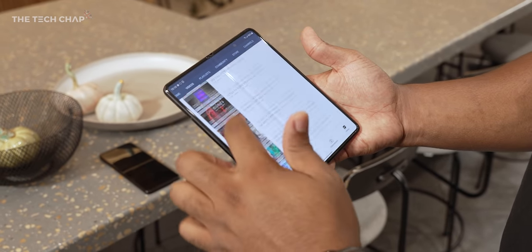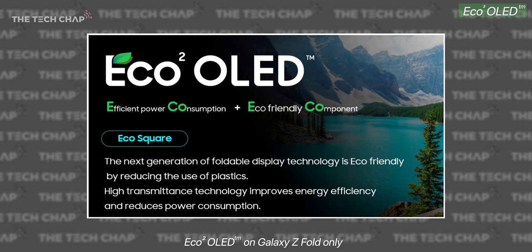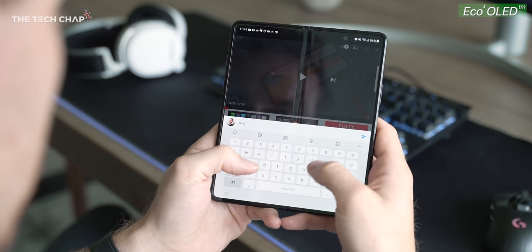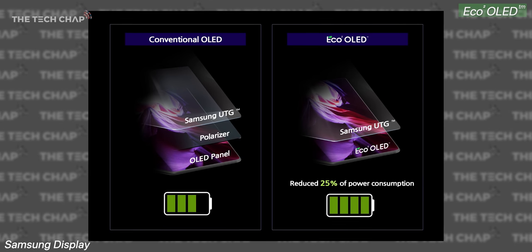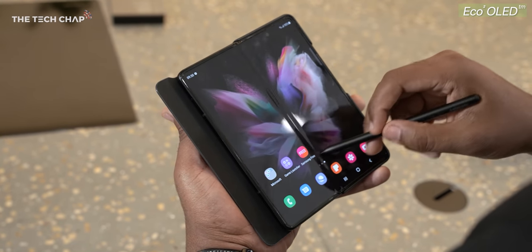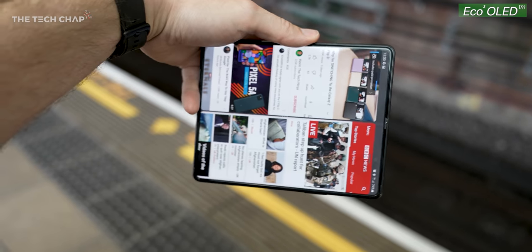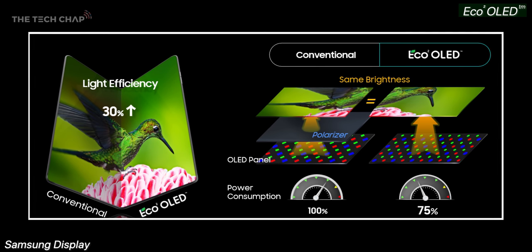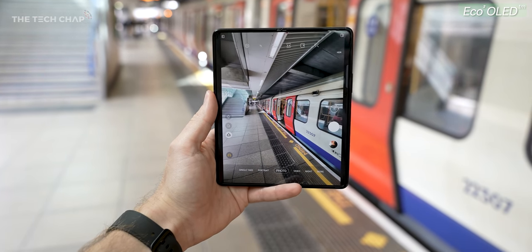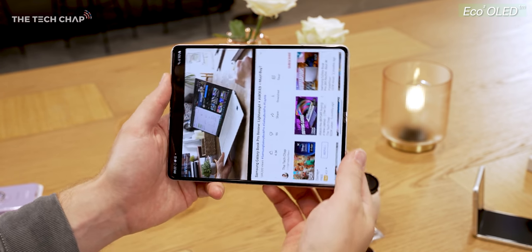So: sharper screens and better balancing of green light. But there's another benefit of the Fold 3 — eco square OLED — which is Samsung Display's push towards efficiency and eco-friendly components, specifically using less plastic overall. The efficiency part is particularly interesting: eco square OLEDs ditch the polarizing layer between the OLED panel itself and the UTG, or ultra-thin glass, which sits on top. That polarizer actually reduces how much light the screen can emit, so removing it boosts brightness. An eco square OLED can therefore be just as bright as a regular OLED while using 25% less power — and that's on top of the Fold 3 already being 29% brighter than the Z Fold 2. You're essentially getting extra brightness at no extra cost to battery life.